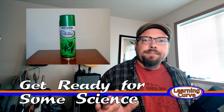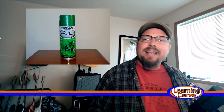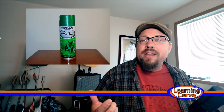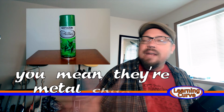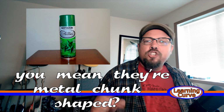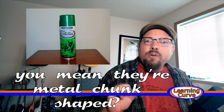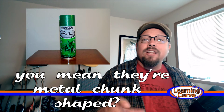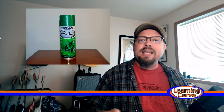Here's the thing. Glitter paint has little chunks of metal in it, and that's what makes it glittery. And those little chunks of metal are shaped like little chunks of metal. They're not shaped like paint molecules. They're shaped like chunks of metal. So they don't interact with things like clear coat the same way that regular paint does. So you have to treat them differently.